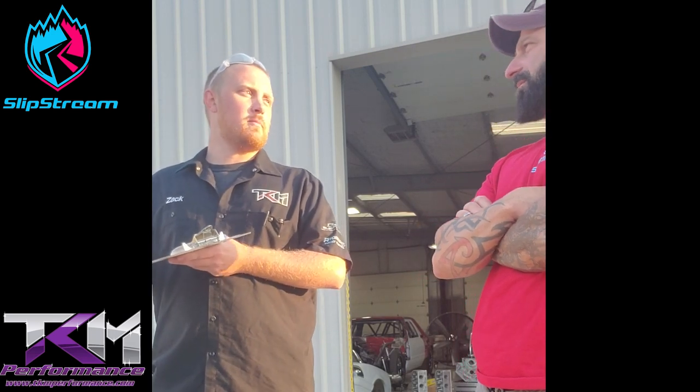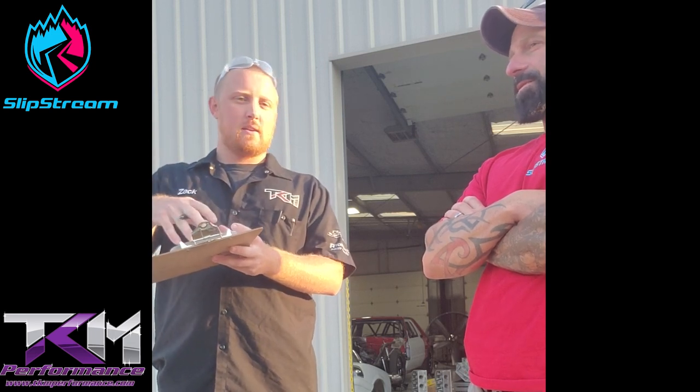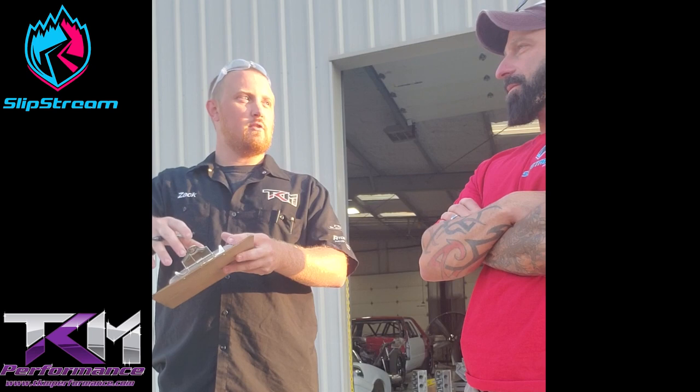I'll let you talk to Kevin about hooping it or O-ringing it if you want to do that, because it's going to be seeing quite a bit of boost. So he'll probably say go ahead and top fuel hoop it, that way you won't have an issue. What is that? The top fuel hoop is actually a ring that goes inside the head, and it's got a receiver groove into the block, into the sleeve, so you have to use a copper head gasket whenever you do that. The ring will push that copper head gasket into the receiver, so once you start cramming a lot of boost into it, you're not slinging.